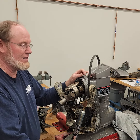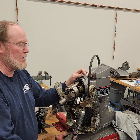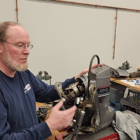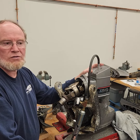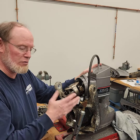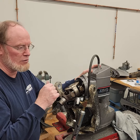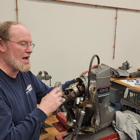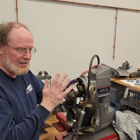If there's a seal leak in a drive, there's water in it — that's why you're there figuring out where the leak is. It's going to leak under pressure for sure if there's already a scored or damaged seal. With older drives like this, I take polishing cloth and polish up the shafts, and I inspect all the sealing grooves. If the grooves are real deep, I have to change the shaft.